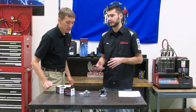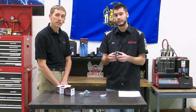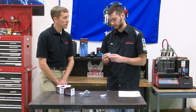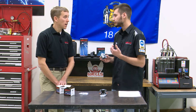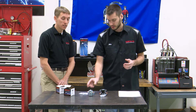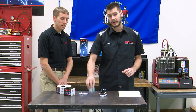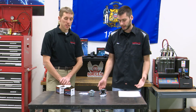Just by looking at them they look very similar, but their uses and intentions are completely different. Remember: the F496 is intermittent duty — to power up your starter for a short burst of energy when cranking the motor, that's it. The U1453 is for your snowplow, your golf cart, maybe even a salter on the back — it's meant to stay on and run up to 80 amps continuous. It's definitely the highest amperage continuous duty and the most common universal type.